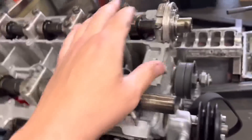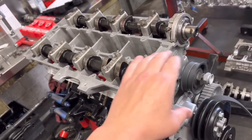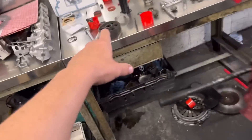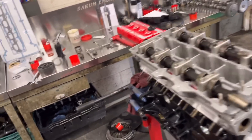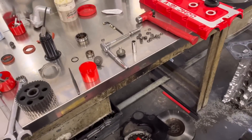They've basically put the four-wheel drive seal on the two-wheel drive system, and you're trying to do the cam pulley bolt up against rubber - that's why they were loose. That runs the risk of those bolts coming loose and everything falling off. But you can see I've stripped it all out, cleaned up the bearing, cleaned up all the shafts, put new cam seals, greased everything up. I'm going to blast these pulleys, give them a nice lick of silver, get this thing timed up, get that lovely cam cover on there, and this engine is pretty much done guys.